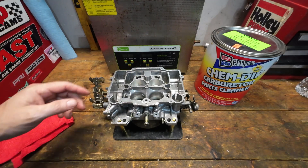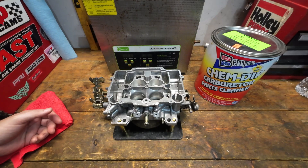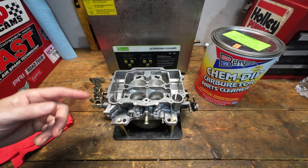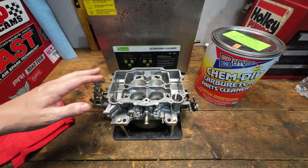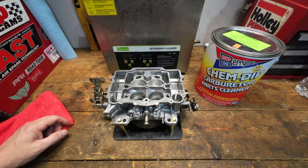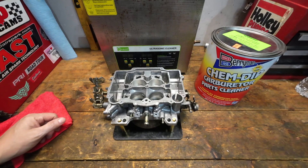It is kind of a protective coating on there, and you have to be careful with all that. I would not use that ultrasonic cleaner for more than two cycles in there — generally one will get you everything you need. This carburetor was pretty bad; it wasn't the worst I've seen, but it was bad enough that you had to be a little careful. So that's kind of the pros and the cons out of it.